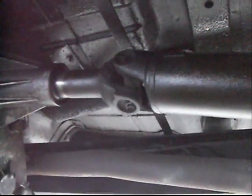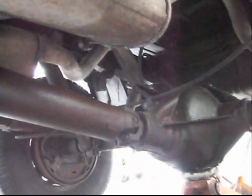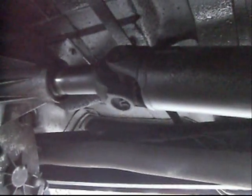Chevrolet sounds better. Anyhow, we've had a bit of discussion about drive shaft angles. This is leaving the transfer case on the much longer Suburbans, and the drive shaft is, I don't know, 5 or 6 feet long. It's supposed to leave the transfer case pretty straight so it doesn't put too much strain on the U-joint, which has to work back and forth. This is stock. We got the back end up in the air, but it's jacked up from the axle, so it doesn't change too much.